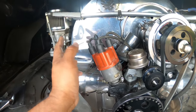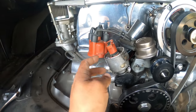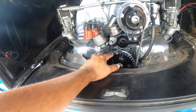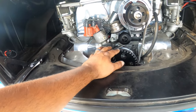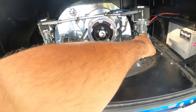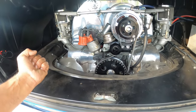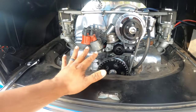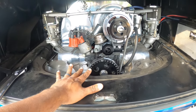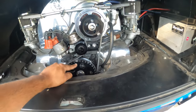So right now this is number one. Follow your wire and then know which one is cylinder number one. Then you're going to crank your engine clockwise. Make sure your engine's cold — you don't want to do this hot. Crank it clockwise until you get to cylinder one TDC.